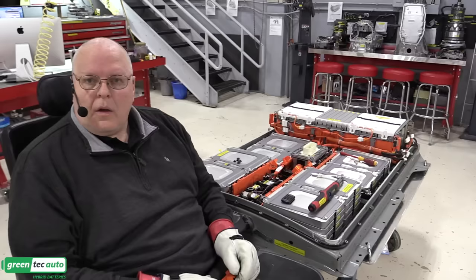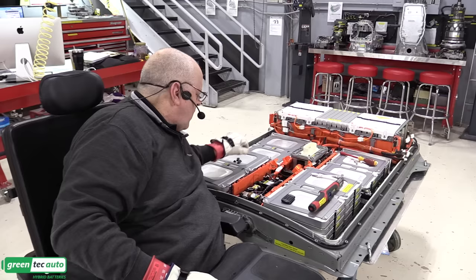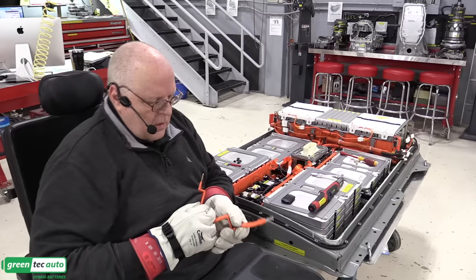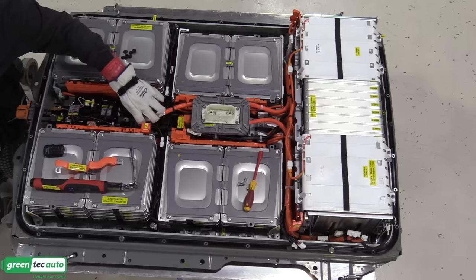Okay, we're just about done. We have two more bus bars to install to put more battery modules in series with each other to increase the voltage, and to connect the overall battery negative terminal over here to our contactor assembly here. So I've got one bus bar that connects module 36 to module 37. 36 is right here on the right, so this is going to go across here. Let me get this big cable from battery positive down on the